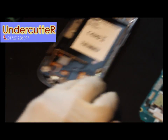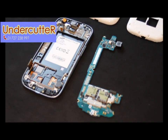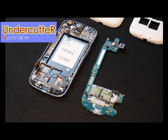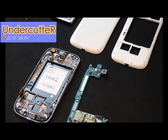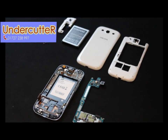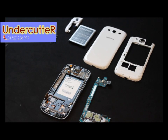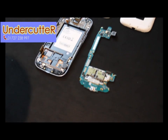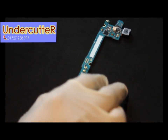As you can see, the assembly is very similar to the Galaxy S2, which means repairability might be quite difficult because the LCD, digitizer, and middle chassis all appear to be moulded into one complete unit. Repairers of the Galaxy S2 will notice some similarities between the two handsets. This probably means it's going to be quite an expensive repair unless we can get the individual parts separately.